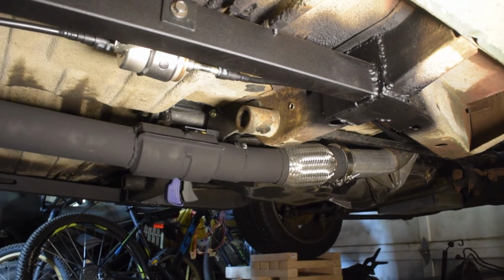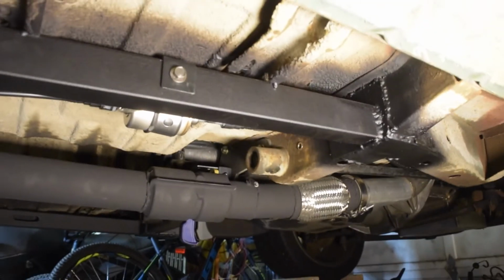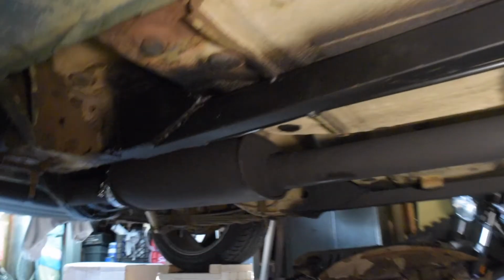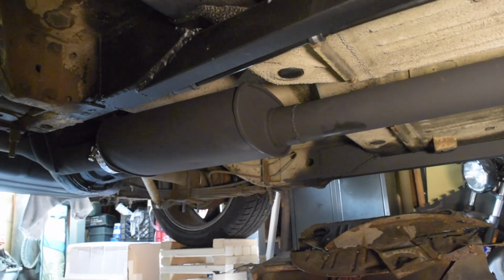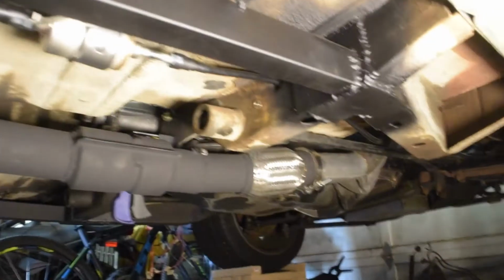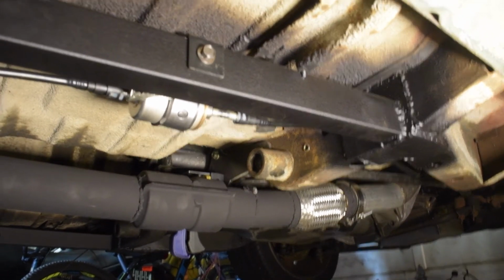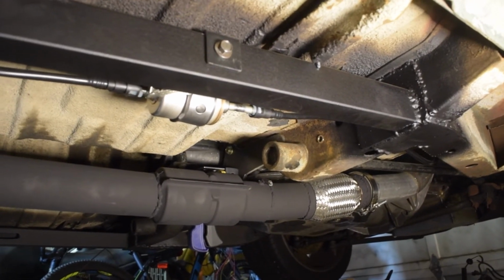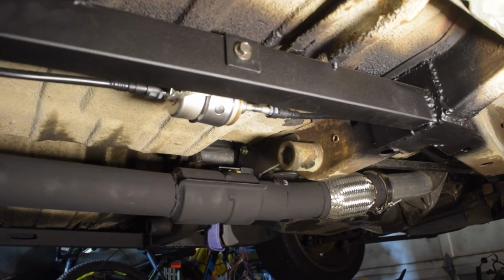Basically, the system was putting too much stress on the mount pivot point, and it was rotating down, which caused the entire exhaust system to rotate down. The muffler wasn't straight and looked sloppy, so I redid that. When I take the transmission off, I've got to paint that crossmember that I made anyway, so I'll probably do a threaded hole to mount that mount in there.